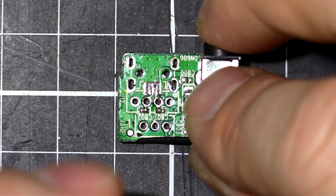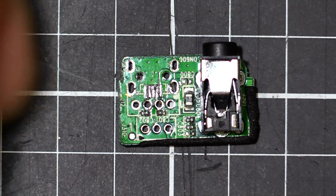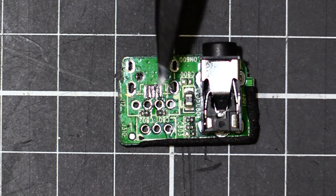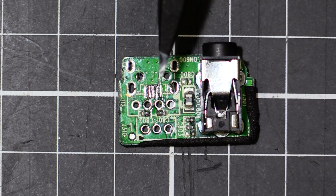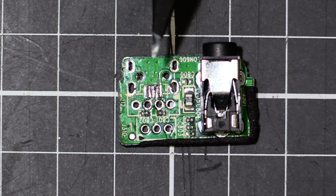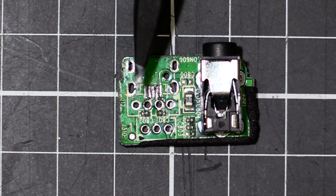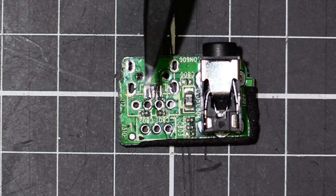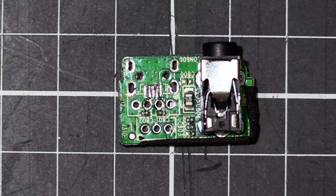They're just next to the existing holes, right next to them, just a little bit down from the hole. So all I need to do really is enlarge those holes, and because they're on the bottom, it's kind of good rather than being on the top, because the force is going to be pushing in. So even though I enlarge those holes, the force is in the direction of where I'm enlarging them. So the pushing force won't push any further.